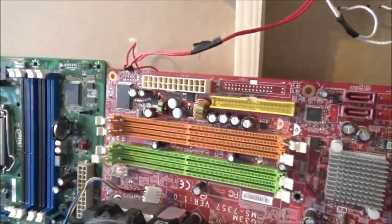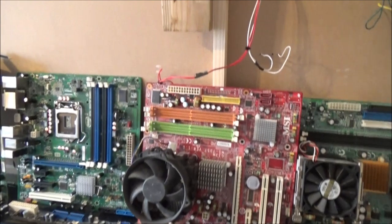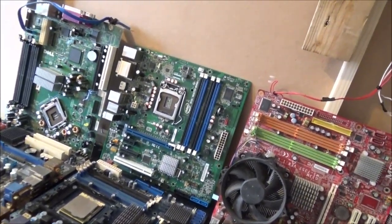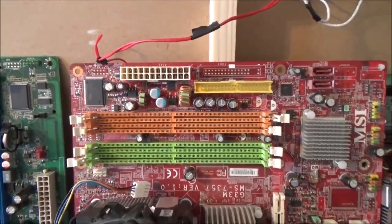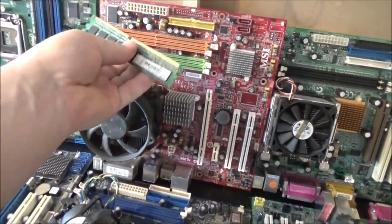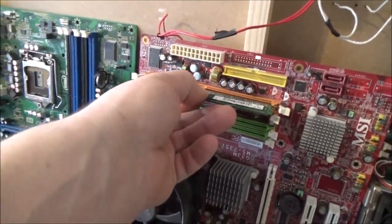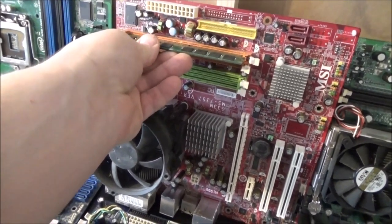That one's got the PCIe slot, but I can't remember whether that RAM is DDR2 or DDR. I think, looking at those DIMMs, they're DDR. It's actually hard to see at a glance because there's not a lot of distance between the... That's DDR2. And I think that one is as well. So if you look at the notches on these... Not a lot in the way of differences. There's another DDR. Yeah, I'm pretty certain that is DDR on that one. I will grab... It's one way to find out. I've got some DDR sticks here. Cool. DDR. 1 GB DDR. Why is that not in one of my Windows XPs? Right. Well, that notch does not line up that way, and I don't think it's going to line up that way around either. If it doesn't, then this is a DDR2 board. It is a DDR2 board.